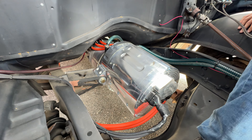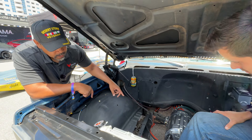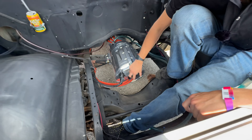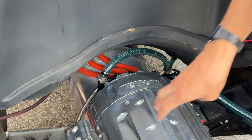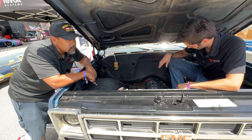From the battery pack you get 400 volts that comes right into the DC in — that's your inverter, which tunes it into AC. You've got your three phases out to the back of the motor, and behind that there's a two-to-one gear reduction box.